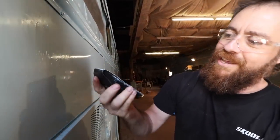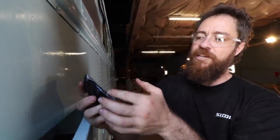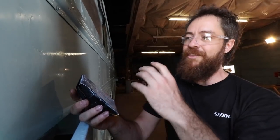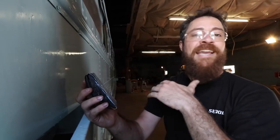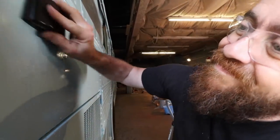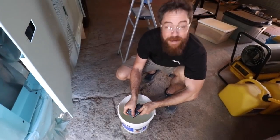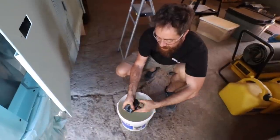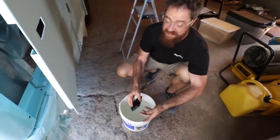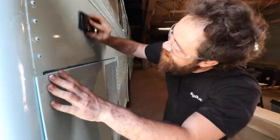Another tip that they said was put 2 or 3 layers of the sandpaper that you're gonna use. So if the top one tears, you're not going straight to the block and the block doesn't start marring your surface. Instead, you've got a fresh piece of sandpaper to continue working. Whoa, that's a great tip, Brian. As you can see here, the sandpaper is starting to get loaded, but with rinsing it off with some water, it seems to be kind of wiping off. So this is a pretty cool trick. Never done it before, but it's doing pretty cool.